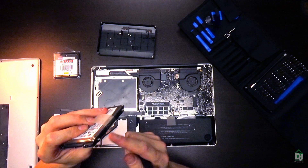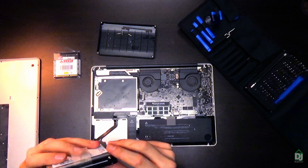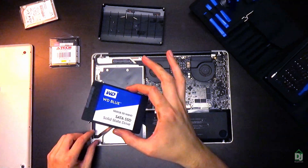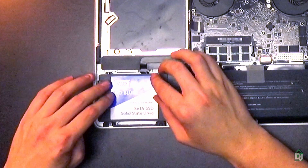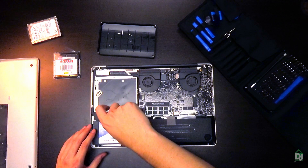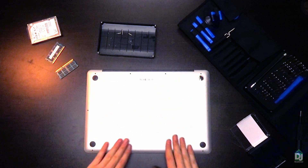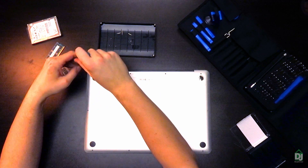We're going to need these mounts to mount the SSD in place of the hard drive, so switch these little Torx bolts into the SSD — this Torx bit is a TR6. Now that you've got the mounts into the SSD, put the ribbon cable onto the SSD. Lean it into the same slot the hard drive was sitting in, make sure everything lies flat, grab your bracket, place it over the SSD, switch back to your double zero Phillips, and screw it down — make sure you don't cross thread. Put the back panel on because there is a grounding switch that prevents the computer from booting without it — it will give you a frowny face if you try.